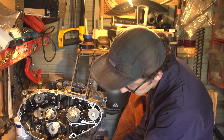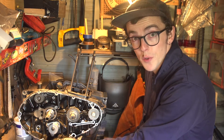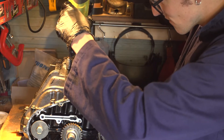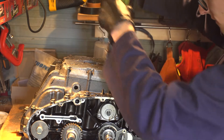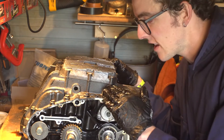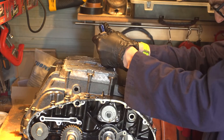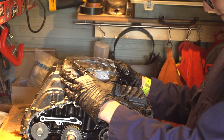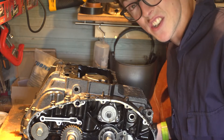First job is taking the oil strainer off the sump at the bottom. So we've got to get the engine flipped, take that off, and then there's a few bolts under there I can undo, and then it's just the rest of the bolts to take it apart. It doesn't appear to be any leverage points to get it off, and I don't want to wedge anything in between the mating surfaces because if you damage it you won't get a seal. There we go. The gasket's stuck to the engine — that's a bit of a pain.